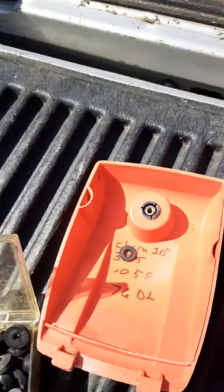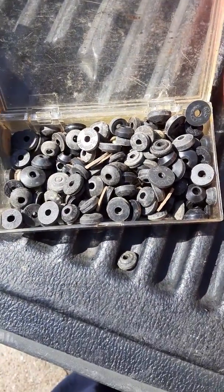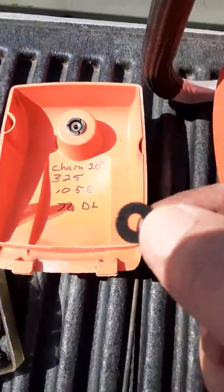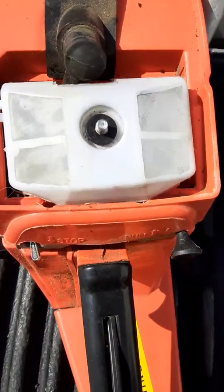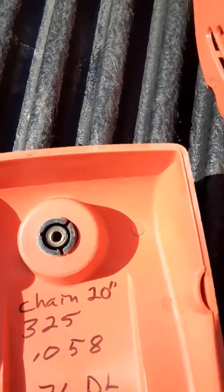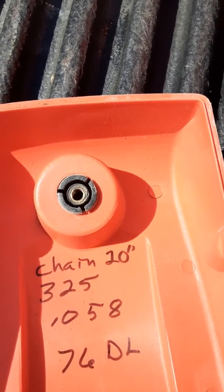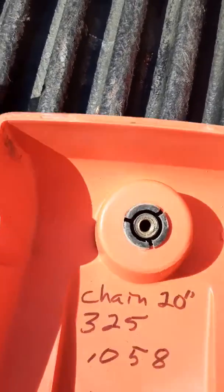When you go to the top, you should also make some kind of washer for the top. I simply had a bunch of plumbing washers, picked one out, opened up the neck just a tiny bit, and stuck it on top. There you have a much better seal, because this nut that seals up has got three spaces on the side, so it does not seal to prevent dirt from coming in around that screw.